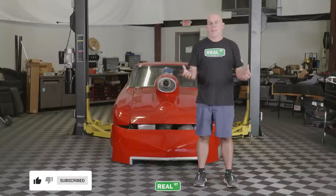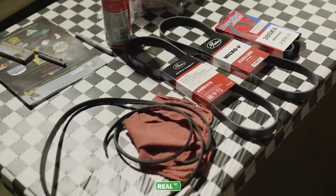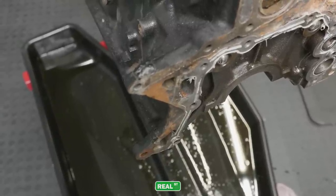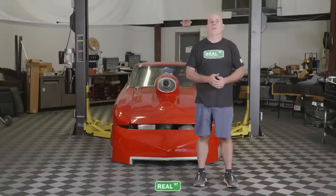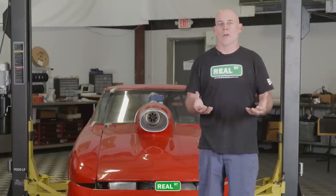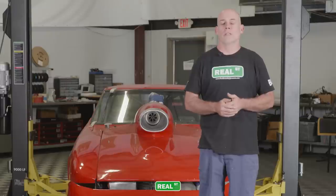During that process, the driver accessory belt had fallen off more than once, so the car had made some amount of time wide open throttle without a functioning water pump, because the ear on the engine block had been broken off in the past, and when they welded it back on, it wasn't quite straight, so it kept pitching the belt off. So we knew that we had overheated the engine, but these types of things happen, so we don't know exactly what kind of damage had occurred. It's still a running engine, although cylinders 5 and 6 aren't as strong as the other cylinders.